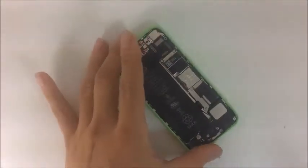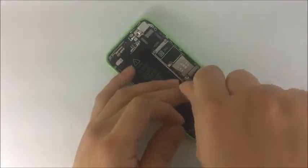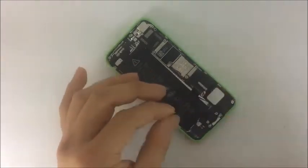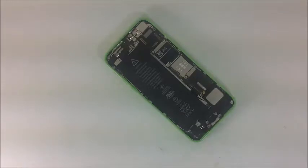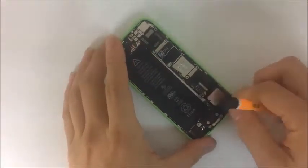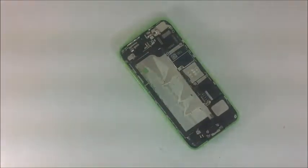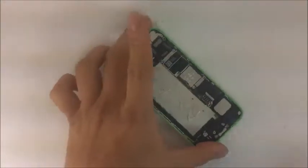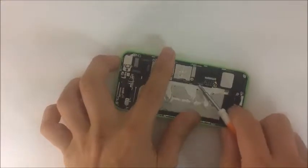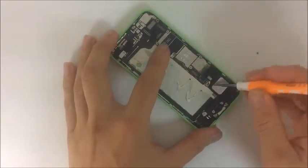Then we're going to go a little bit deeper and show you some more micro parts. We're going to remove this shell right here, which covers the battery flex and also the charging dock flex. We're going to remove the battery flex right here, and the battery comes off without too much effort. Sometimes there's a lot more adhesive, so you might need to heat it, but at the same time you have to be careful not to overheat the motherboard. So just a lot of care, just common sense too, I guess. We're going to disconnect the charging dock right here. There's also an antenna connected.